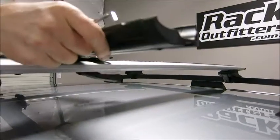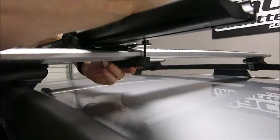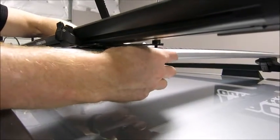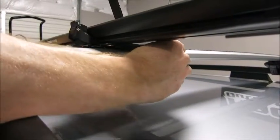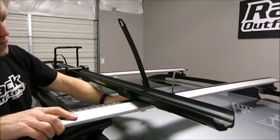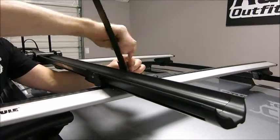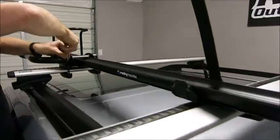I'm going to lift it back up, bring it over the bar, and back underneath — we're just about done now. I want to make sure that these screws are evenly spaced so there's the same amount of space in the front and the back; you don't want those scratching against your bars. Make a visual check or measure the distance from the side of the tray to the end of the bar — make sure it's not skewed on the roof. That's important.